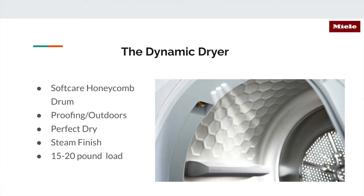They also have a setting called Perfect Dry, which I find really unique and helpful — it applies to almost every setting. All Miele dryers have Perfect Dry. You can tailor it to your specific dryness preference, choosing between Iron Dry, Cupboard Dry, or Extra Dry. A lime-scale sensor measures the moisture in your laundry, so once your towels are dry, for example, the dryer will automatically stop. That way you decide exactly how dry you want your laundry when it comes out of the drum.